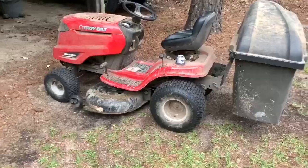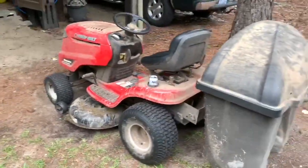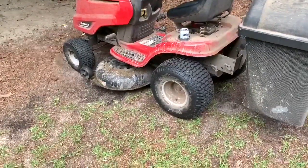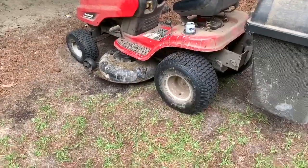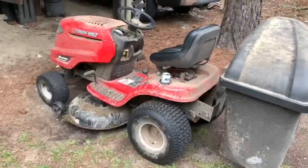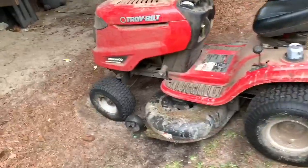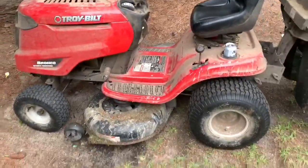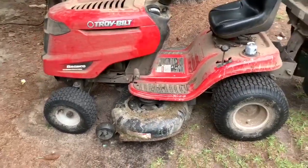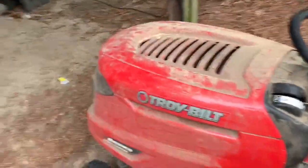Keep the air filter clean. I've cleaned the air filter maybe four or five times and changed the oil maybe four or five times in seven years — I probably should do it every year, but I don't use it enough. I probably cut the grass maybe once a month, maybe twice in summer. A lawnmower's working environment is the harshest available — all this dirt, mud, and whatever's in your yard.